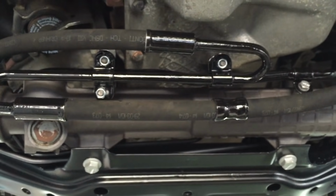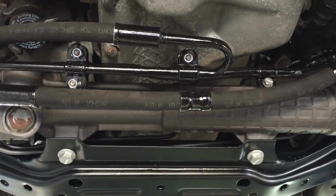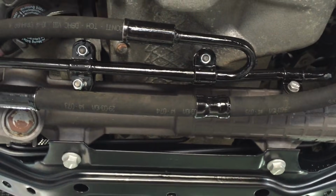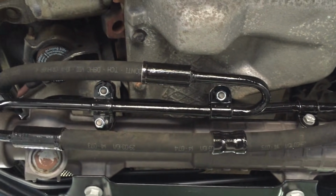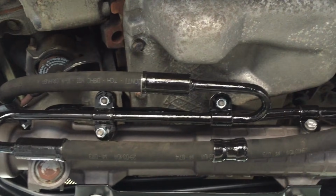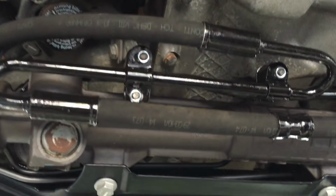And I don't think the steering rack was installed last time, so we've got the steering rack in now with new bolts and new top nuts, and then the high pressure pipe was fine and not leaking, so we've painted the fixing, the metal pipes and the crimp joins with POR 15 rust preventative paint.